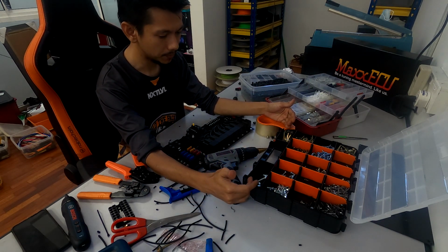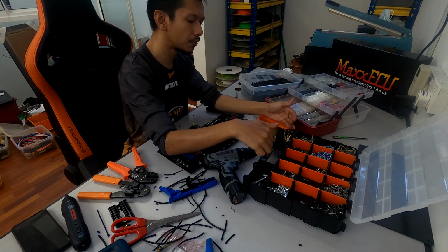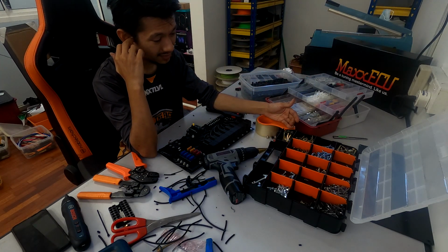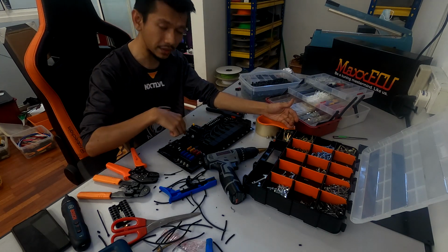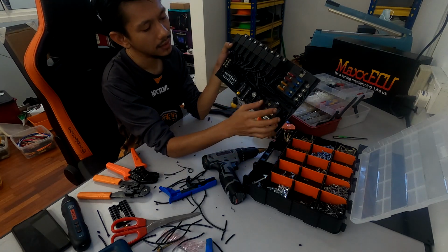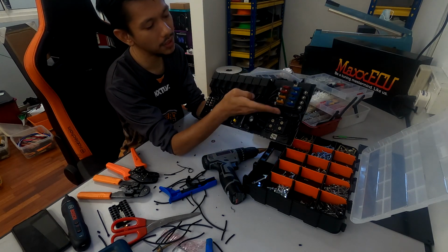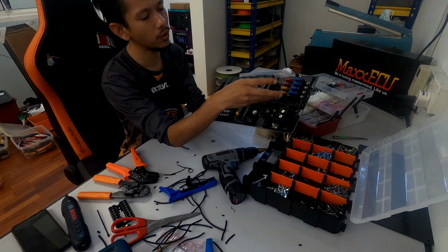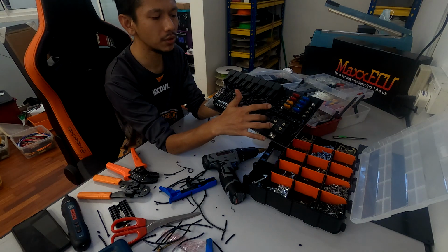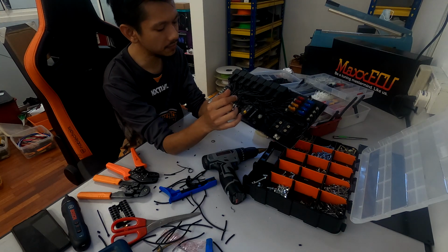If one of the pumps fails, the feed is just gonna push the fuel back all the way to the other pump. And yeah, I don't want that happening. So I might as well just wire it up both together. And I have to also because firstly, I could have got the 8, but there was no space for it. It's gonna be up to here. So I can't have wires and it's gonna be a tight fit, so I just made it 6 because I do plan to run the nitrous together. So I thought, you know, 6 would just be fine.